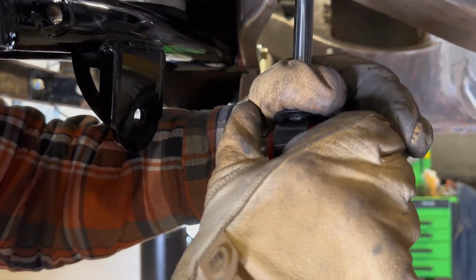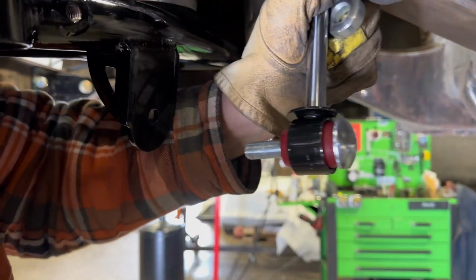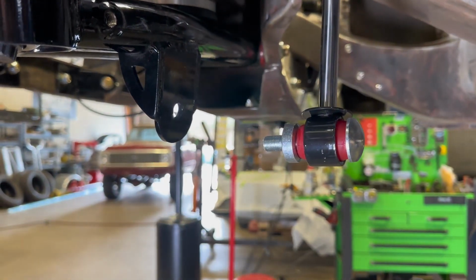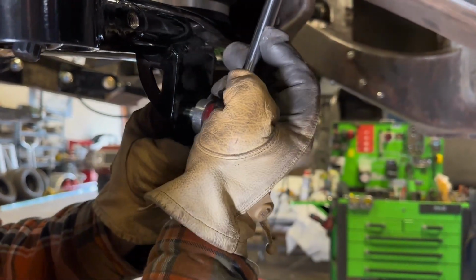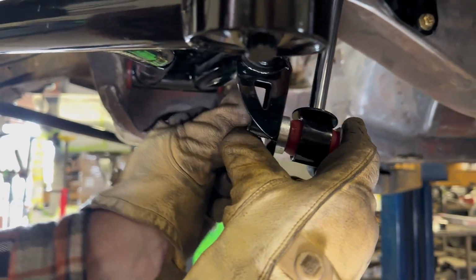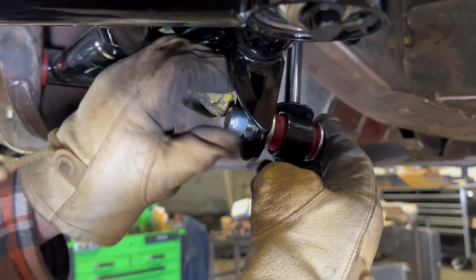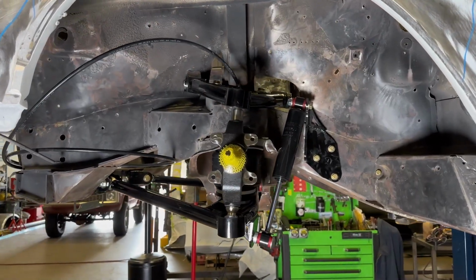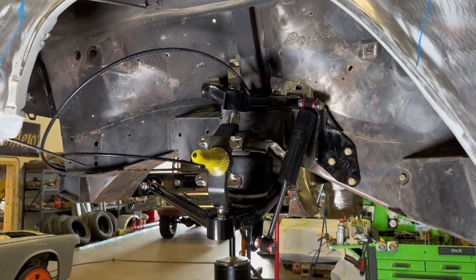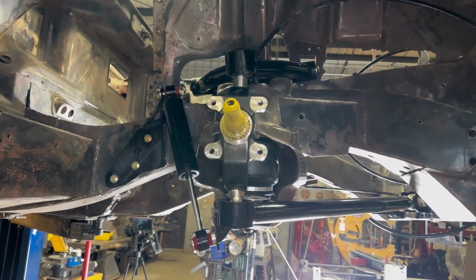Here we're going to show you how the P19 bolt works. It's a rounded head. Slides in. Don't forget to put the spacer in. Bolt to the control arm. Don't forget lock washer and nut. Try not to over tighten this, but making sure it's nice and snug. You don't want to squish the bushings out of the shock. There's a picture with the spindle on. Again, those just slide right on and tighten down. Now we're ready to install the big brake kit.